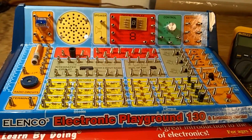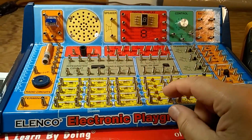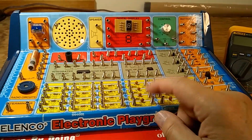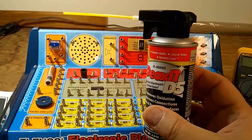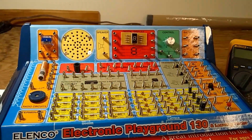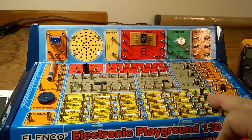I just want to say that this comes with cables for connections. It also has an old-time earpiece in the bag. The springs are a very clever idea and should snugly connect to the wires. If you have a problem with the contacts, you can use contact cleaner — it's excellent stuff. It's about $18 for a can now. You don't want to spray directly on the spring; instead, spray it on a Q-tip and wrap the Q-tip around the spring on each of the contacts, and you'll find it working like a charm.